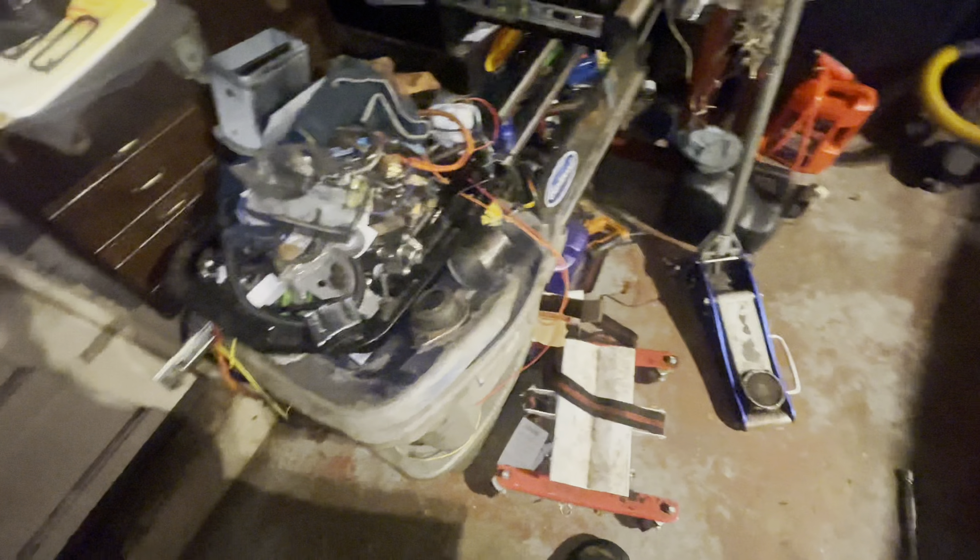You could get Ziploc baggies and label them, which I've done also. I'm pulling both brake calipers, brackets, and rotors off. I'm going to zip tie the caliper up out of the way. On my particular Mustang, you will not need to disconnect the braking system because I have two separate soft lines that run up top. If you have a Fox body or a 94-95, you will have the brake line on the axle, so you will have to disconnect your calipers via the hoses and bleed the brakes.